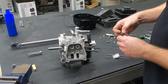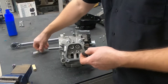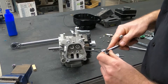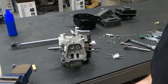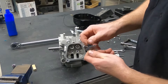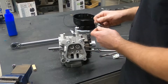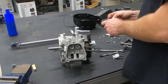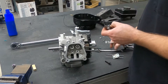Whoever put this together last did not really take the parts right. So I'm going to go ahead and separate these adjustment bolts. Once I do that, the lock nut and the adjustment nut will come off of this rocker. I'm just going to set all of that off to the side as one assembly. I'm also going to do that to the other one.